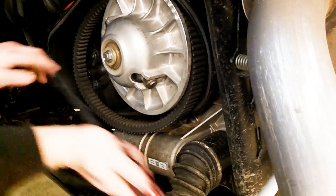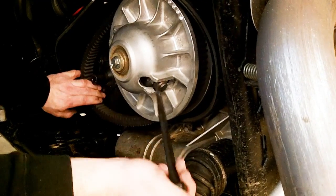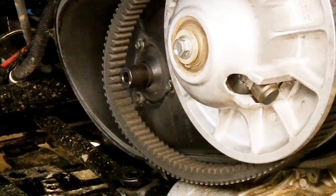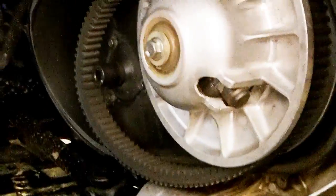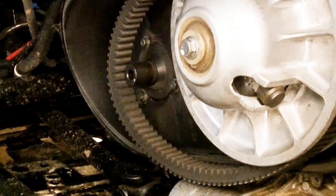And if you really want it down in there, grab a screwdriver, and that really goes. Once you got that done, put the primary clutch back on. One thing on the primary clutch is always a good idea to clean out this taper here, and also on your crankshaft, just take some brake cleaner again, wipe it down on a rag, clean it out, and put it back on.